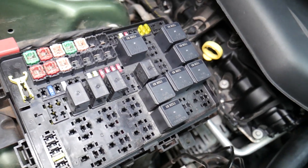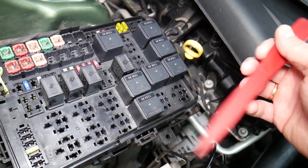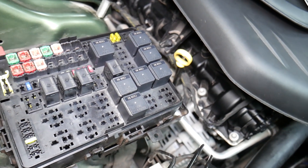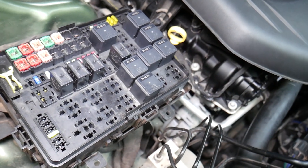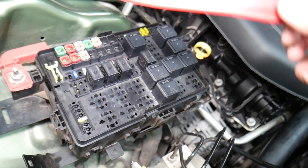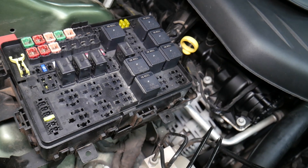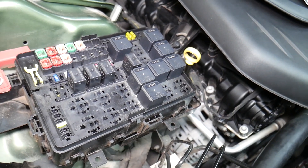It takes only a few seconds to find out for sure if a fuse is good or bad. The same goes for relays — some of those can be really expensive on cars. We'll put a link in the description on how to test relays. For certain fuses, it's important to disconnect the car battery when removing them, otherwise you can burn the electronics. For airbag fuses, wait at least one hour after disconnecting the battery. A common mistake when disconnecting the battery is not knowing which terminal to disconnect first — if you do it the wrong way, you can burn electronics and modules. We actually burned the traction control module on a BMW that way — it cost two thousand dollars.